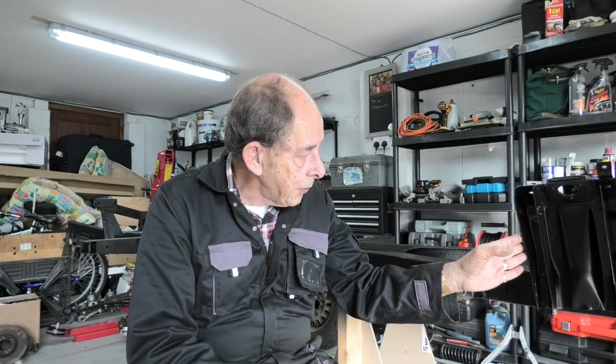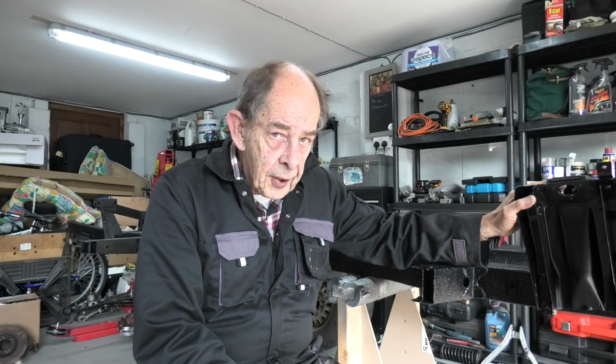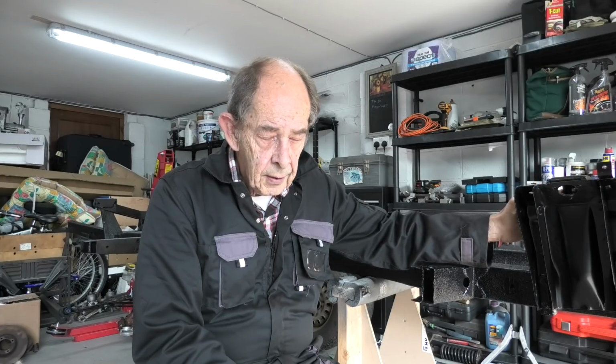And so today this is going to be a doing day. So rather than me waffle on like I normally do, I'm going to be actually assembling for the final time the driver's side front suspension. I've now fitted the turret here, which has now got the revised engine mounting bracket, which sets the engine back 3.5 inches.